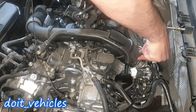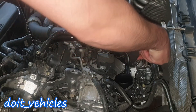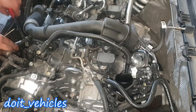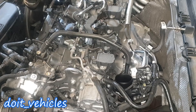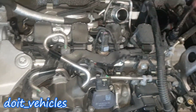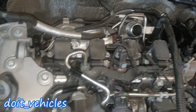We've got here a special hose clamp which can be released with your fingers. So this is disconnected. Now we can take it apart. Now finally we've got access to the coil packs. Again we're gonna need the E10. And let's unplug the connectors.